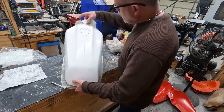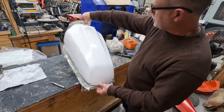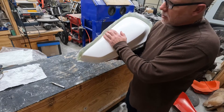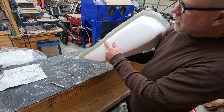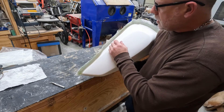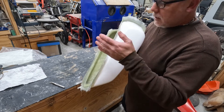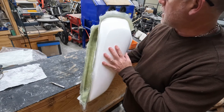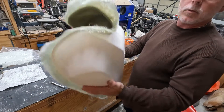Now that's all done — voila — this part is done. I take my die grinder with one-sixteenth inch thick fiberglass reinforced cutting wheels on a pneumatic die grinder, and you can see I have a nice parting line. I typically cut a little bit above where this parting line is so that when I have glue, I have a lot more area and I want the glue to squish outward. Then whenever this is all glued together, I can take my belt sander and clean the edges up really nicely. Voila — there's the first top tank half. It looks really, really good.